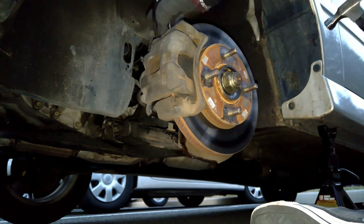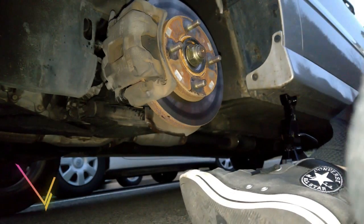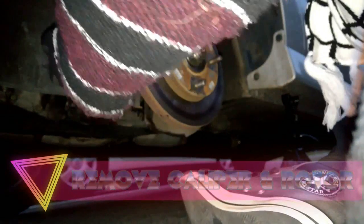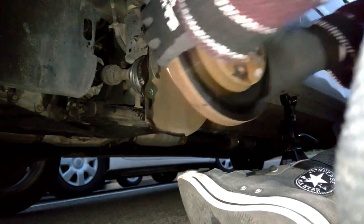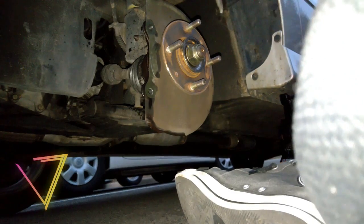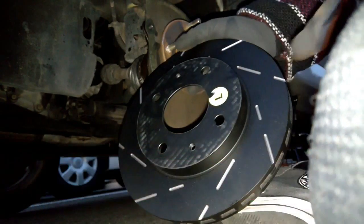This is when you're going to want to use your hammer to try and crack the bolts. These are extremely tight even with WD-40, so take your time — for me this took about 20 minutes. After finally getting those off, remove the caliper and the rotor. To keep your brake line straight, just rest the caliper on top of the disc brake flange — as you can see there, and it is nasty. Then install the new rotor. Pretty.